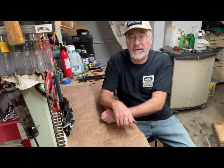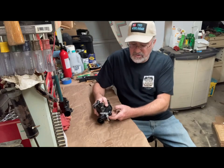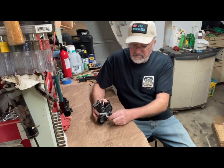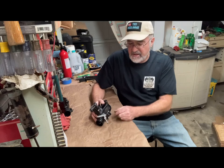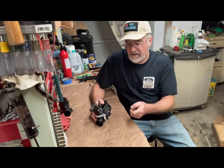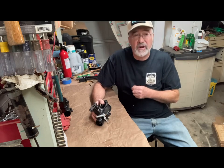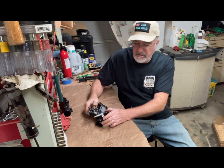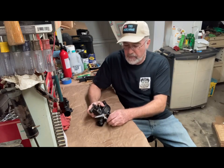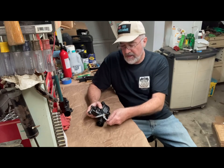So that's about it on the carburetors. Just a side note, when I was looking at this, the early ones of these choke levers only came to here, and this part's cut off. Then they figured out when you're hand cranking it, you want to put a wire through here and go up towards the radiator, so you can just pull the choke, crank it, and then push the choke back in. So later early models don't have this part of the lever, but all the later ones do.